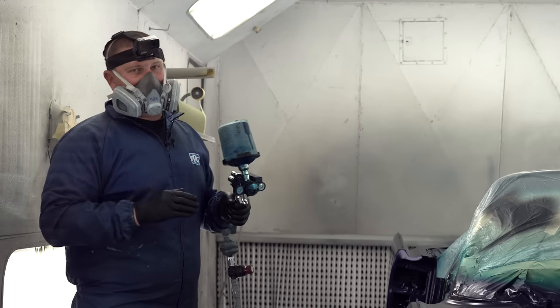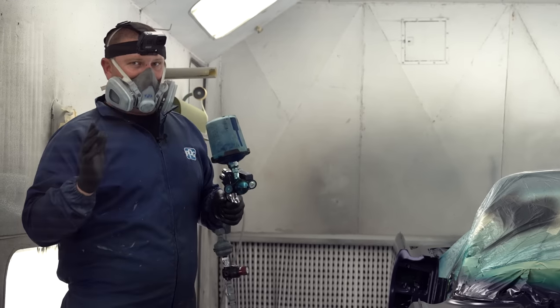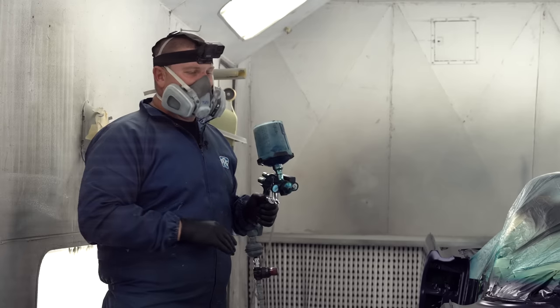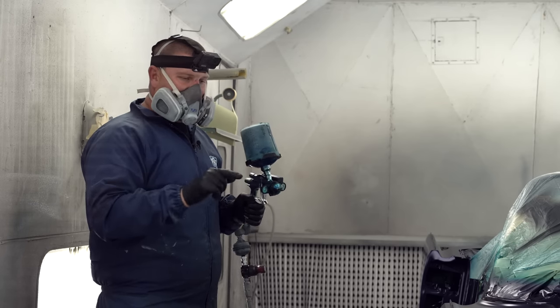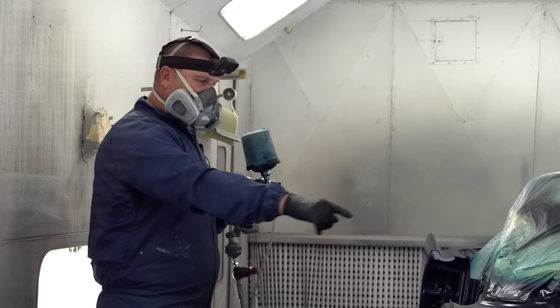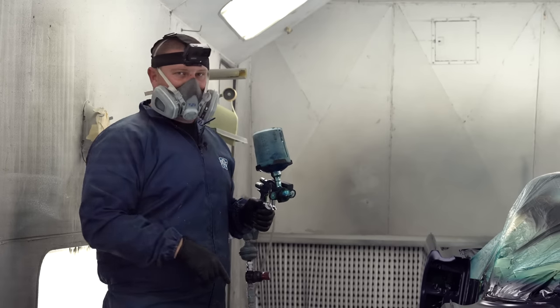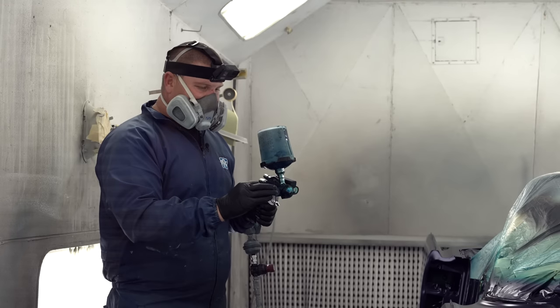I think it's maybe a little excessive. You probably only need two, and I've gotten away with one, but we have the paint. I want to make sure this thing looks perfect. So I'm going to do three coats this way. I also am making sure that the three coats that I've already put on has completely flashed off and it's not extremely wet. So it's putting a bigger droplet.